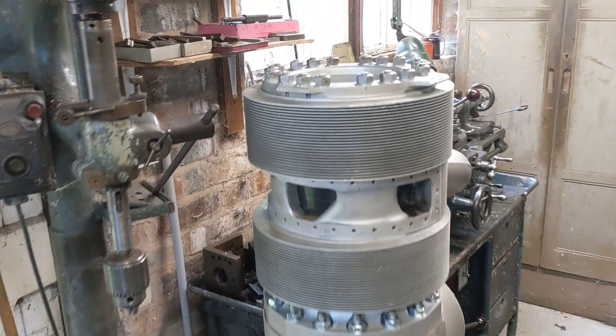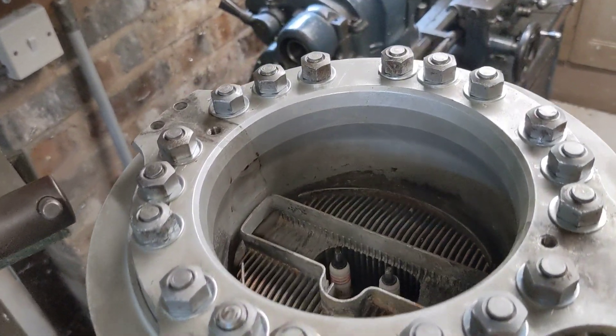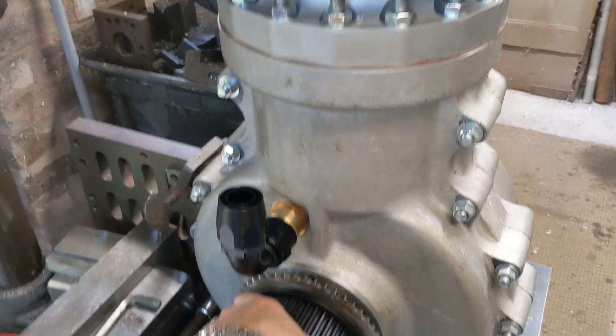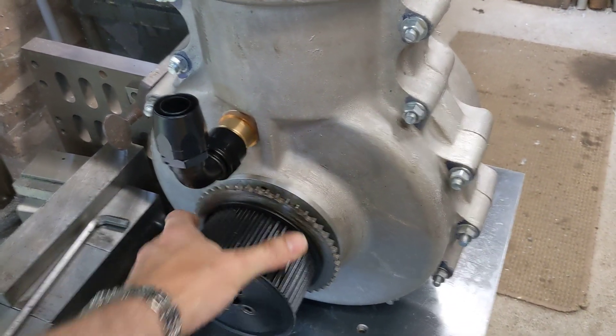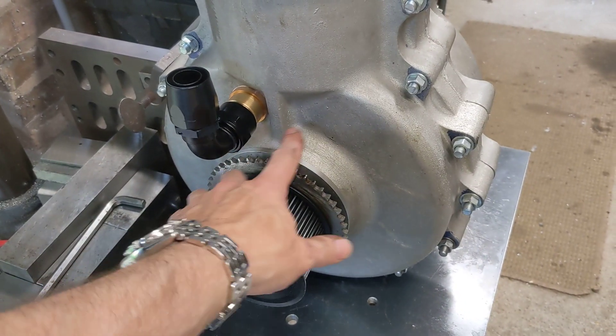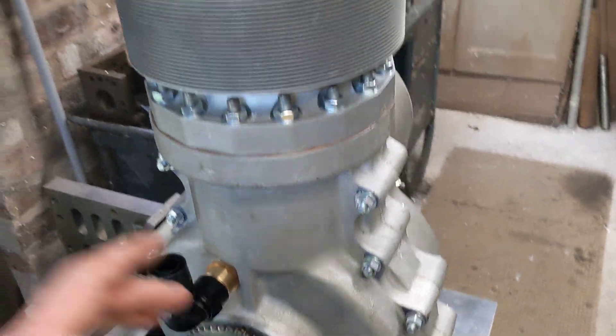The cylinder head is in place. We've got the cylinder head rings down over the sleeve, no problem. Sparking plugs are in place. There is compression because you cannot turn it by hand anymore. The one-way valve for the breather is in place. I've checked the chain run here and there is enough clearance to where the Dynastart is going to go.